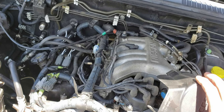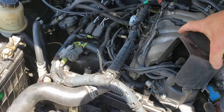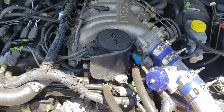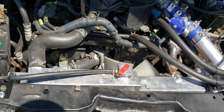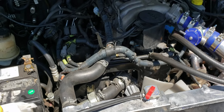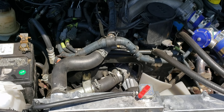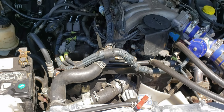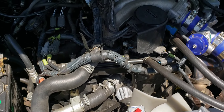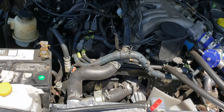This cover is off an earlier Pathfinder — you just have to shave off a little bit of plastic to get it to fit. It prevents moisture and dust from contaminating the top of your plug wires, so if you can find one at a junkyard, I'd recommend it. Overall, it all works. I'd like to get a fan shroud, but even at 92 degrees yesterday hitting boost, I never saw any overheating. The motor's been fully rebuilt with OEM parts, except for ARP head studs and aftermarket coated VG33ER pistons. Brand-new OEM water pump, oil pump, and thermostat from Nissan, and NGK spark plugs.